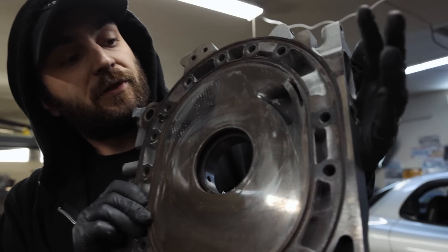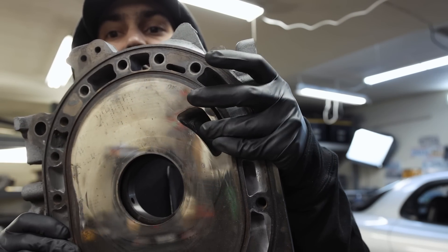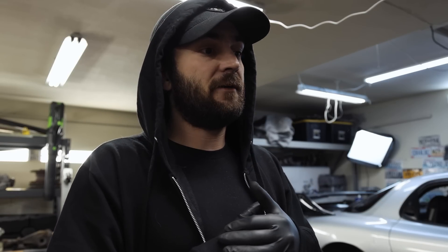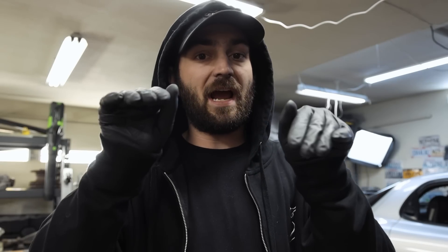I've already gone ahead and ported the front iron and didn't blow through the cooling jacket, which is a plus. On the front iron we've got the bridge done, we've got the port shaped, we just need to enlarge the ports and then polish them. For the center iron and the front iron we're in good shape. The rear iron I have to wait until the new one comes in, which sucks. I'm going to do a little more porting with the tools I have now, then go to the hardware store to get the longer port tools for the exit of those chambers. The most important thing is to be very, very careful.